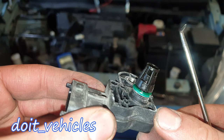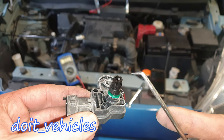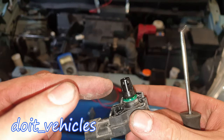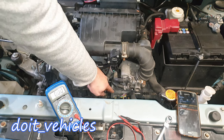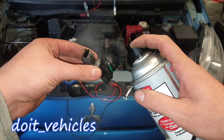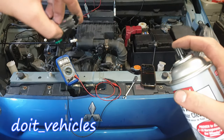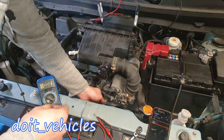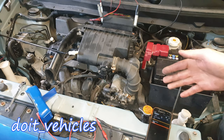This sensor has a lot of oil buildup on it. This oil can affect the readings of the sensor. It's not enough to only clean the sensor itself, because if there is oil here it's going to be on the pipes as well. When I take out the intake manifold and replace the gaskets, I'll clean that pipe too. I'm using mass airflow sensor cleaner — there's a lot of gunk on it and the fluid is turning black. Clean the surface as well. Now let's install the sensor back — it clicks in.